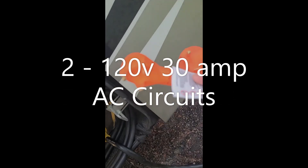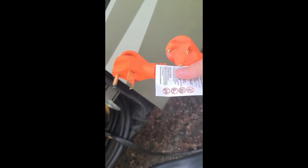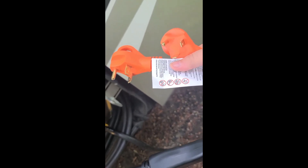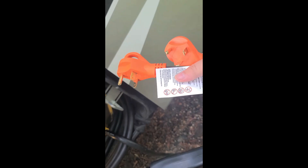Once it's plugged in, what we have is two 30-amp RV plugs. If you have two 30-amp circuits at the RV park, this should provide you two 30-amp, 120-volt circuits. That's not enough to run the whole RV, but you should be able to run both ACs, then shut an AC off if you need to use the microwave. Coffee makers can also be very high power draws.